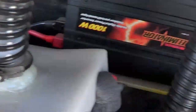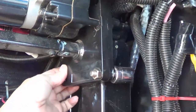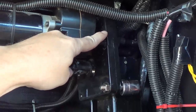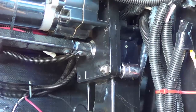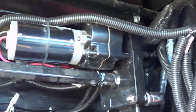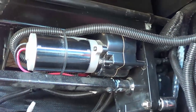Going into the front compartment here — there's the old gearbox. What that does is it takes the motor, and for every three turns of the motor it reduces it to one turn on the landing gears. So it looks like my first job is to get this motor off, so I'll do that first.